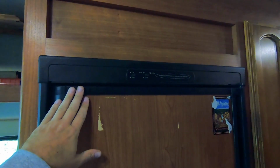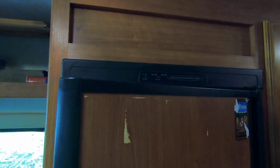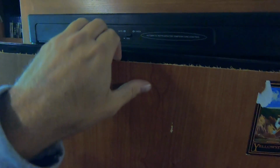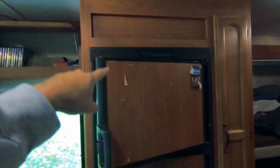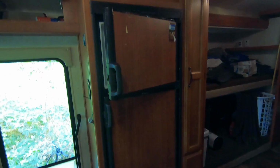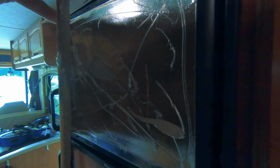And for this particular Americana Dometic, we need to remove this first. We're going to open the freezer a little bit. Check with yours first to make sure though, but this top thing is actually just going to kind of pop out. Okay, and then we'll put this aside. And now you'll kind of see what kind of wood this is. Now, clearance may be an issue, so make sure you have enough clearance. See, that's not going to work for me very well. So I'm actually going to have to bend this out a little bit, bow it out, and get it past one of these sides in order to remove this. The bottom piece, same thing. Make sure you have enough clearance to slide that piece out. There may be some glue, some stuff that you may have to pry. Just be gentle with it. You can see my glue pattern there. You just got to slowly pull that away. And there we go. Okay, and you're left with this beautiful monstrosity.